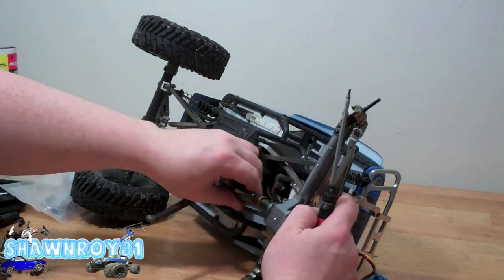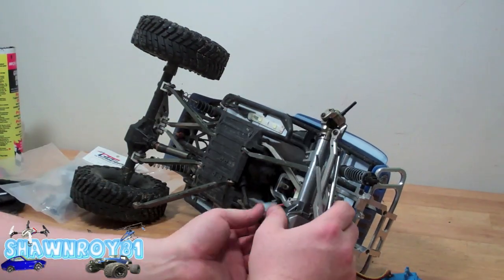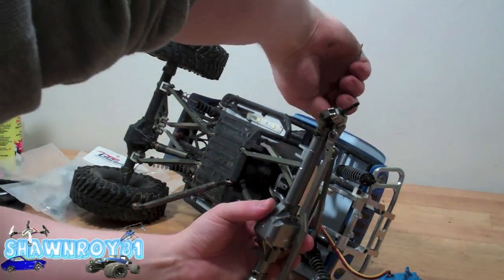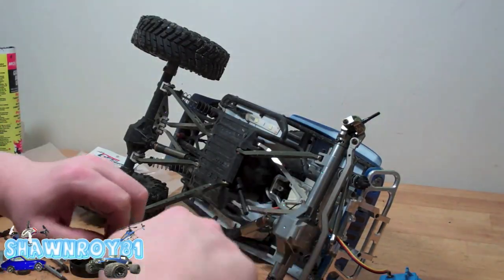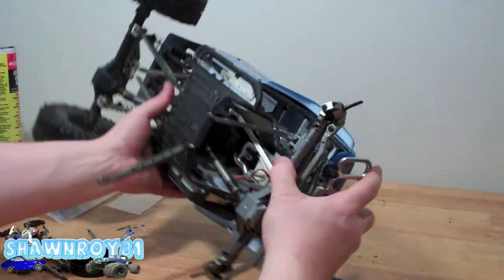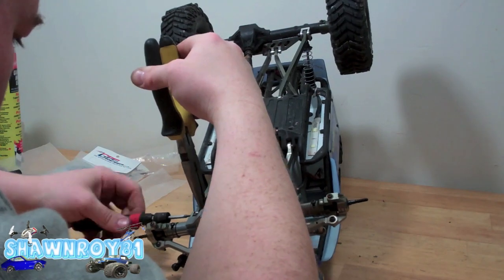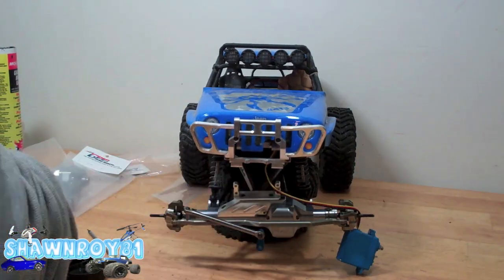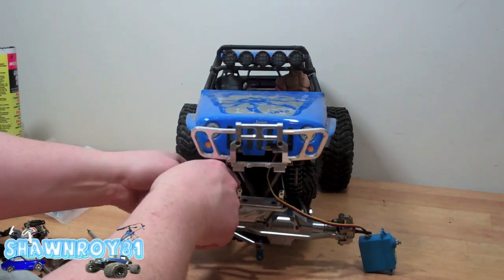Just line up the drive shaft, which is going to continue to pop until we get those upper links in place. Alright, screwing in the upper links, now down to the lower links. Here I'm going to put a nut on the opposite side — not that you need to, you can just thread lock it in, but I've had issues on the trail so I'd rather be extra safe. The least amount of trail repairs the better.